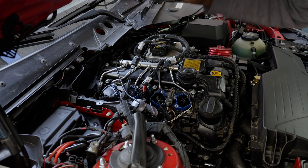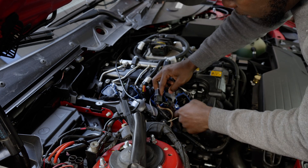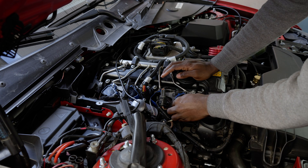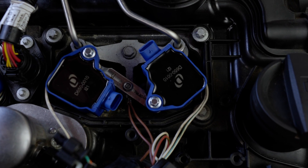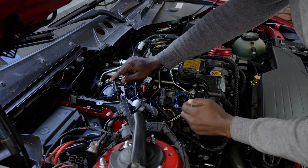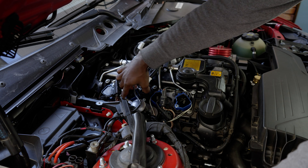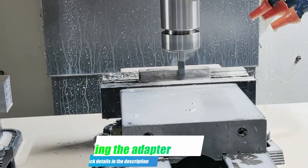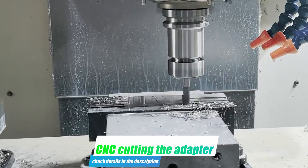This cable connects right here into the B58 coil and snaps in right away. The coils also come with a mounting adapter — I made these myself, took the measurements — and they sit right on top of the neutral line. You just remove one screw, place the adapter, and you can place the B58 coil on top of the adapter. Without this adapter you won't be able to use the coil. Someone mentioned a fitting problem, but with my adapter there is no issue — you use the OEM fuel line that connects to the high pressure fuel line and it goes in without any problem.